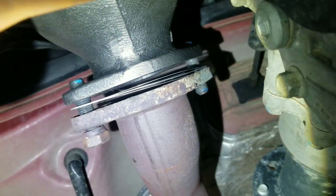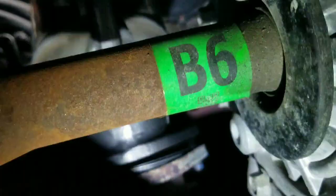Don't forget your new gasket for here. I threaded that with the finger. This is a flex pipe. They're easy to move around and get together. But you want to be able to have it movable to get this on there to adjust this. This will be the hardest bolt to get in if it's all tightened down already.